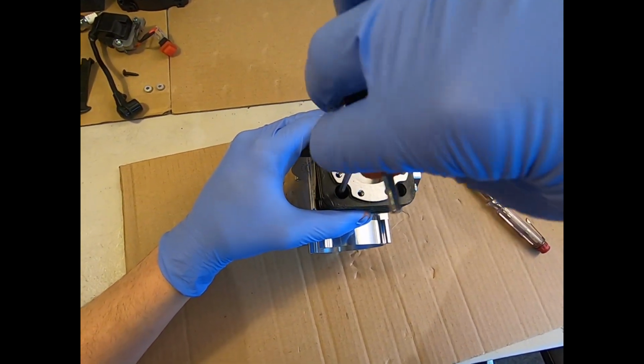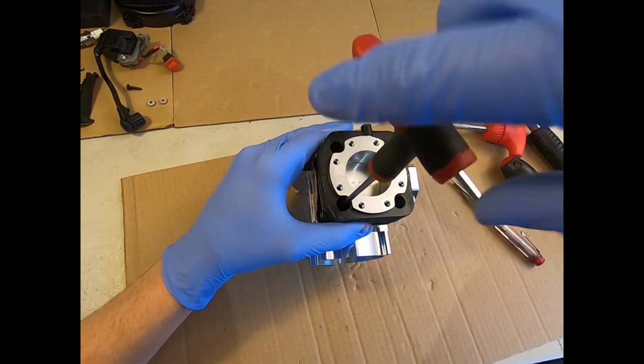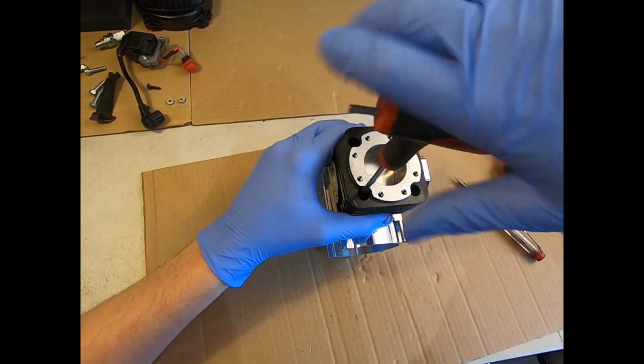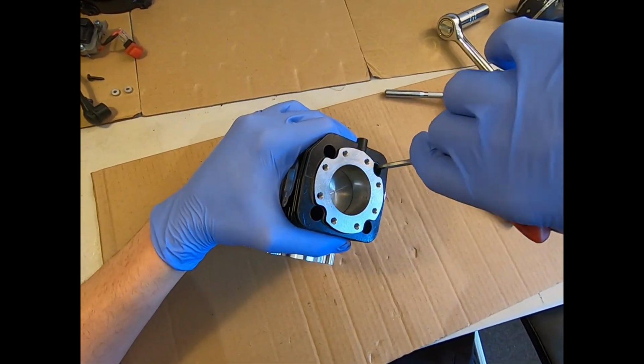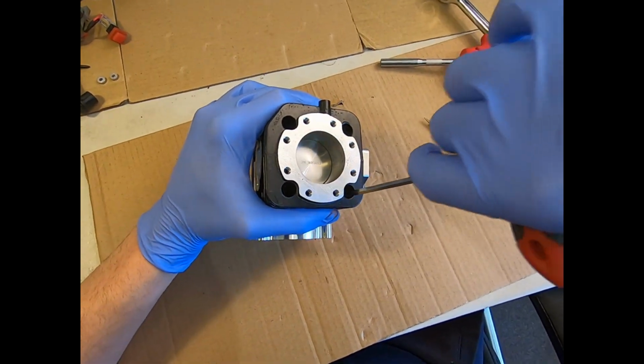And then finally across to this side. Working it across that way, you're pulling the cylinder evenly. You're not doing these both tight and then doing those both tight, just for good practice really. I'm not going to break the torque wrench out now because my hand is a human torque wrench and we don't need to waste time for the video.